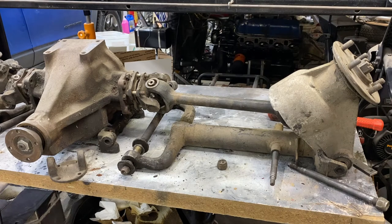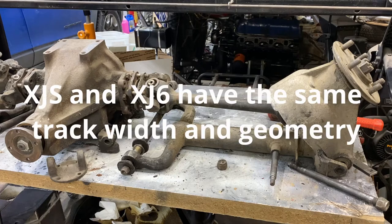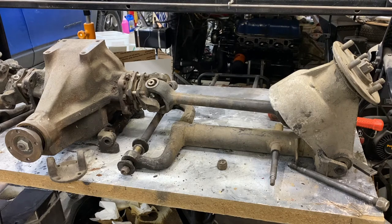I think it's the ease of shortening that makes these such a popular independent rear-end suspension swap for vehicles. There's not a lot of geometry change if you take four inches out of here and four inches out of here — it's going to function almost as designed. That's the way Jaguar did it over their various cars. The XKE had a much narrower rear-end; this came out of an XJS. When I took measurements of an XKE rear-end compared to an XJS, all they did was narrow up the upper arm and lower arm equally — proof of concept that you're really not going to overly affect the suspension geometry just by lengthening or shortening these two pieces.